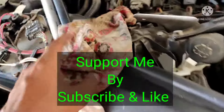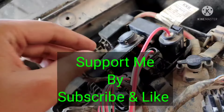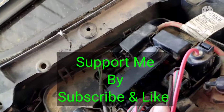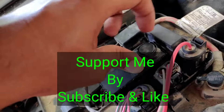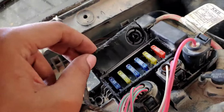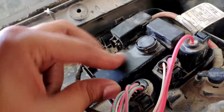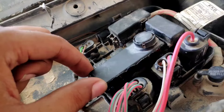After doing everything, I checked these hidden fuses. These fuses are hidden under this cover, so you have to cut this cover — with a hot knife or whatever you are comfortable with. You can cut it from three sides and lift it up so you can access these fuses. I cut this and I found the fuses.